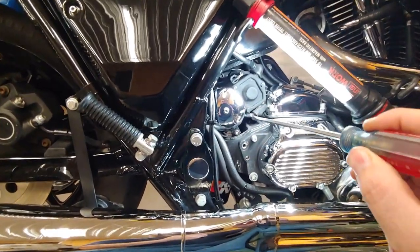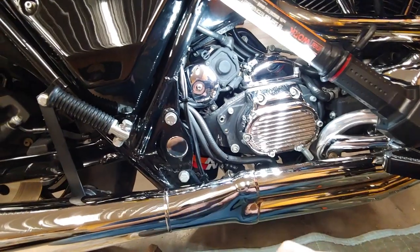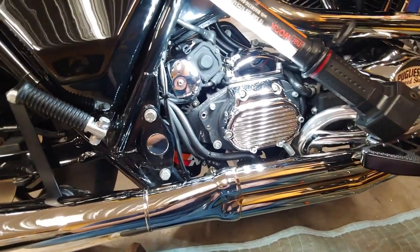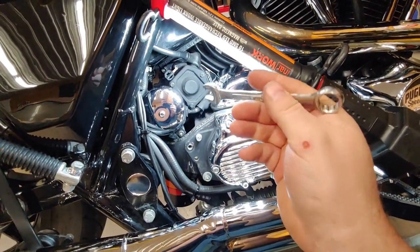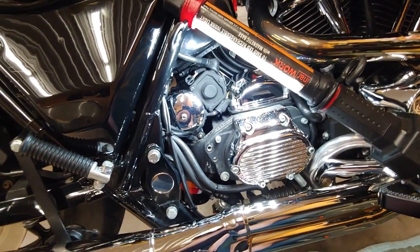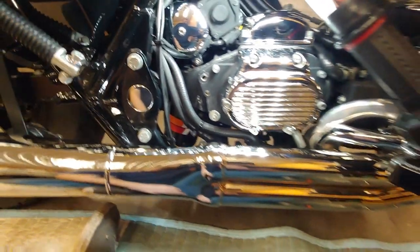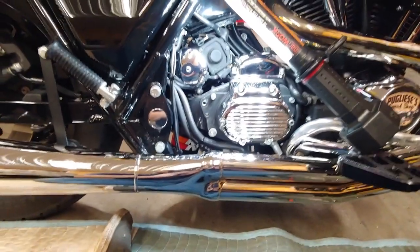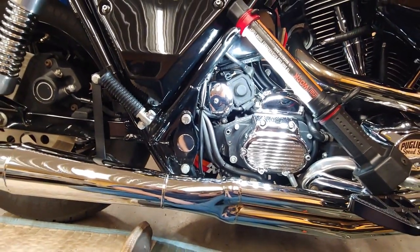After all that, I went back to the cheapest wrench I've got — Harbor Freight looks at this thing and they're like, 'dude, this is trash.' But these cheaper wrenches aren't as precise in the fitment, so you get a little bit of play. I was able to use that play, get it on there, flip it, flip it — did that for what felt like the rest of my life, but it worked. That thing is in there, good to go, no problems. Before I did that, I put a little Loctite on it because I'm not trying to keep doing this. You can reinstall the entire bracket without pulling the starter or the wheel. Took about 20 minutes, maybe. Worth it in my book.